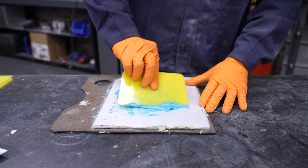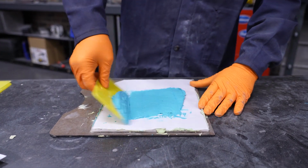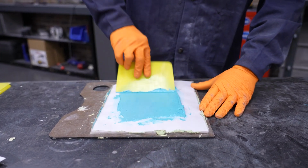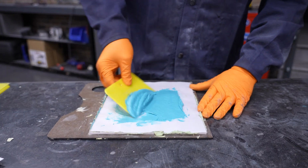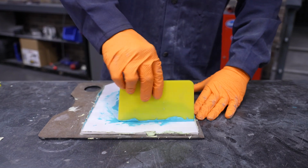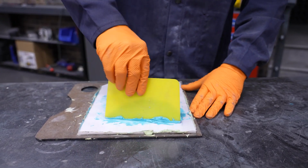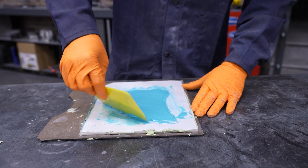We're gonna go a little bit light so that it doesn't kick quite as quick. And then your goal with this stuff is always to keep air bubbles from coming in. So you wanna try and keep it as flat as possible and not introduce more air. Especially for your normal body filler stuff. Because otherwise you have pinholes and then you gotta fill them again. It's a pain in the ass.